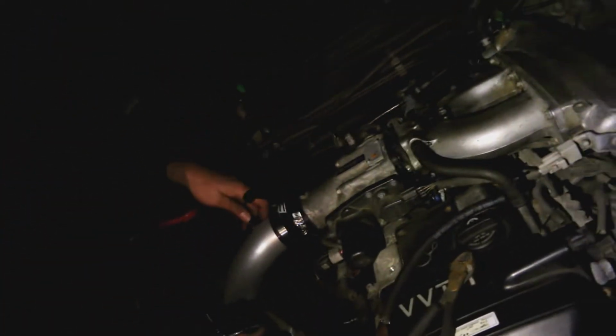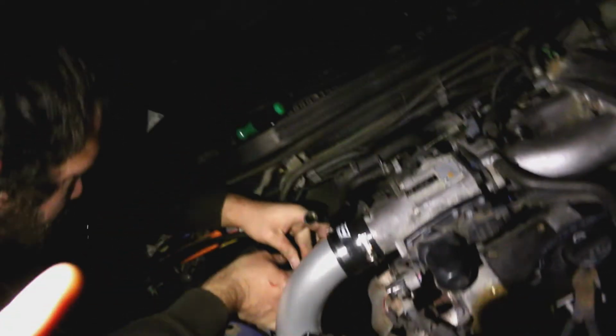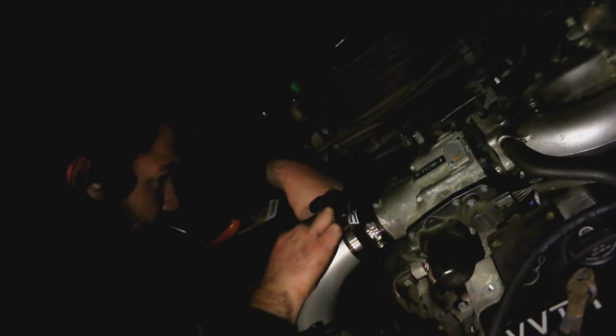It's tightened down there. We're just getting this last bit of hose. Ours is pretty roached. It snapped pretty easily. It is a metal filled line, so we kind of have to make it all fit within that first gapped area on the end. So we're taking some of the hose that DC Sports gave us. It's very flexible, which is good news for us because that means we can plumb it on there fairly easily. If we really tried, we might be able to fit the other end on to the actual crankcase on that side, but it is what it is. Once we get this on, we'll put the battery on, start it up, and see what it sounds like for the first time.